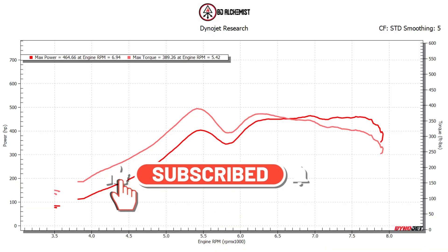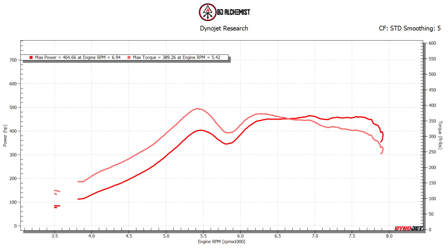This ultimately hit 25 pounds, but it wasn't in a smooth way. The Haltech is currently set up to have a very sensitive response to overboosting. What happened was I hit like two PSI more than I'm supposed to, and it cut, and then it allowed it again. This is part of tuning. I really didn't hit it hard on the street, because there's literally a jail and a police station right next to my shop. So we're going to have to tune the boost on the dyno. We'll correct everything. This was ultimately 25 PSI, absolutely no timing, and the fuel correction was pretty high — I was trying to make it rich. So we're going to correct all that.